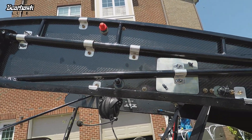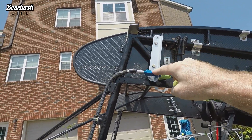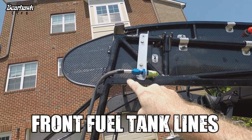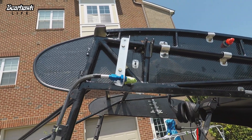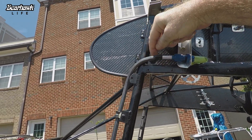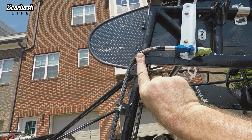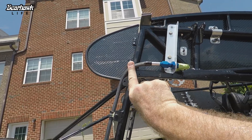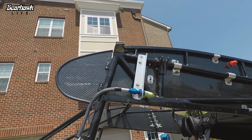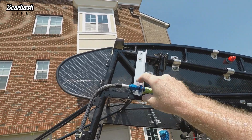Since the last video I also lowered the tube bulkhead fitting down to be closer to this top longeron, and I still don't think I'm finished with that. I'm going to do something to get it a little bit closer because my windscreen comes up and it's starting to push against that fuel line. This is probably my third iteration - like everything else, you do it five times before you get it right, and I'm just going to keep doing it till I get it right.